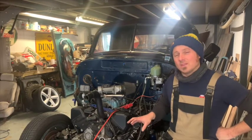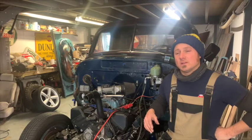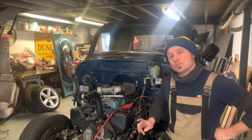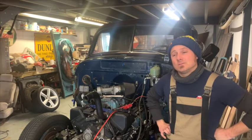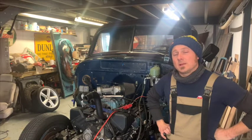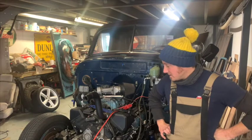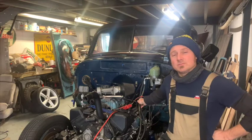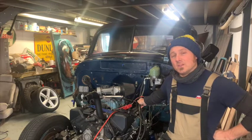Well, I've got a slight weird thing that once it's pressurised up, it has tended to slightly wander to the right. So I don't know whether I've got a dodgy rack. It's brand new. I'll be contacting people I got it off, if that is the case, or whether it's just this incorrect pressure is making the rack do a bit of a funny thing.